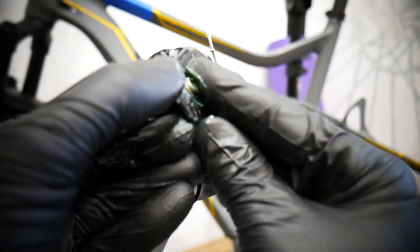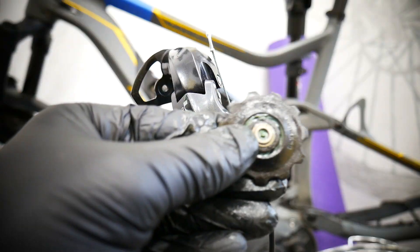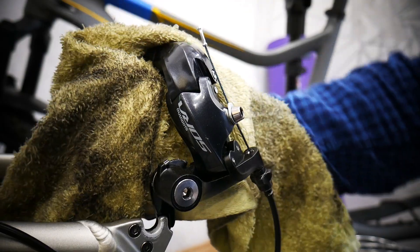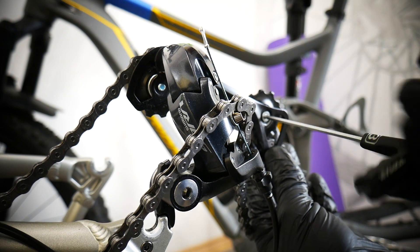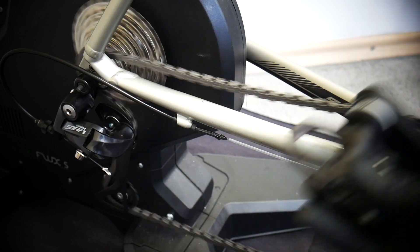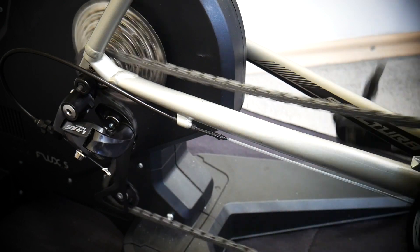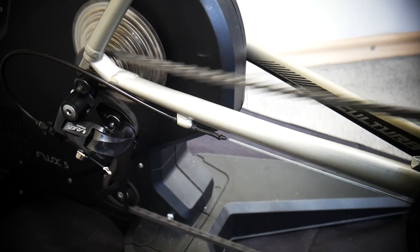The Brunox didn't fix the problem, so I cleaned the Brunox away and put more grease, and that solved the issue. Just put a lot of grease - that's the thing. Otherwise you can just upgrade your Sora derailleur with some nice pulleys with bearings, but you can do it right now and it's very good. It's easier and cheaper but it works. Make sure you maintain your Sora R3000 well. Let me know which part you'd like to see in the future - bye bye!